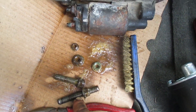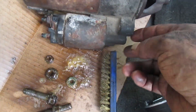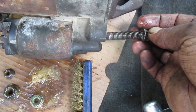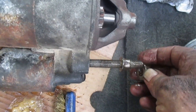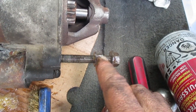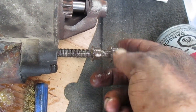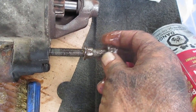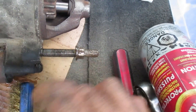Once you go to reinstall — if you have to reuse your old bolts and nuts as I do, clean them off with a wire brush and some kind of cleaner. One thing worth mentioning: the top bolt on this vehicle, which is fairly common, goes in like this, and you're going to have a nut that goes on that. When you take this outer nut off you may think you're loosening up the starter, but in reality you're not. This bolt is part of the whole nut assembly. When you take the outer nut off, a wire is going to come off — the purpose of that nut is just to keep the wire in place. So you take the outer nut off, take the wire off, and then you loosen the bolt from the bolt head — that's part of the whole bolt assembly.